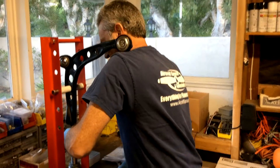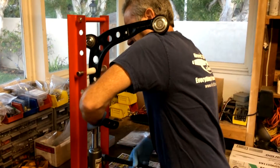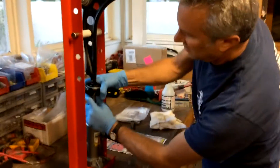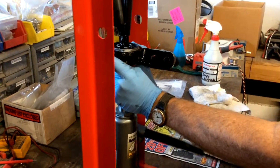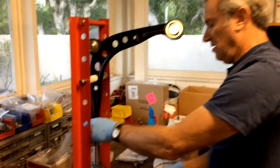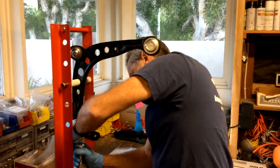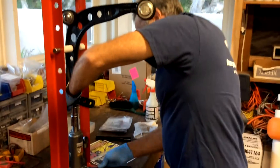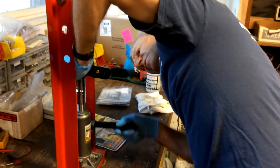I'm going to put my shoulder into this thing to give a little support and pump it up just a little bit to get things started. I pressed it all the way on to the end of the pin. Now I have to do a little changeover on the socket I have on the base — I'm going to flip a socket upside down and finish the press. This could be a little tricky with all the soap, but you have to be sure to align the socket with the center of the bushing.